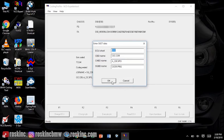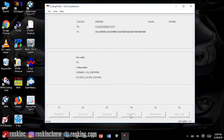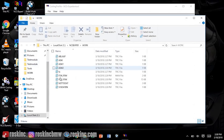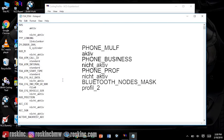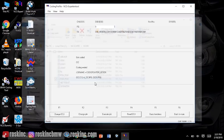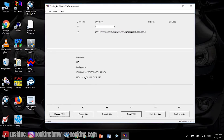Once you're done, Change ECU and select the CIC — or in your case, select MASK if you don't have navigation, or CCC if you do have navigation. Select Read. Go through the same steps as before: exit, open and read the file again. You're going to look for either 'phone_MULF', 'phone_business', or 'phone_prof' — one of those should be active. You can't have all three active; it'll be one or the other. Save it the same way — Save, then Save As with .man — and then Change Job, select that one, and Execute Job. That should be all the coding needed to activate Bluetooth.